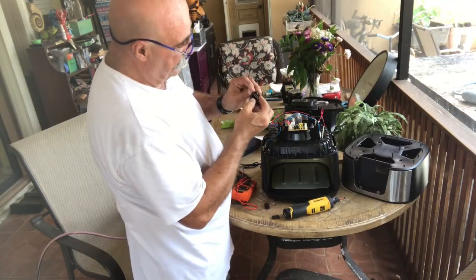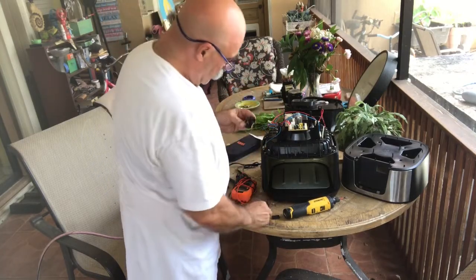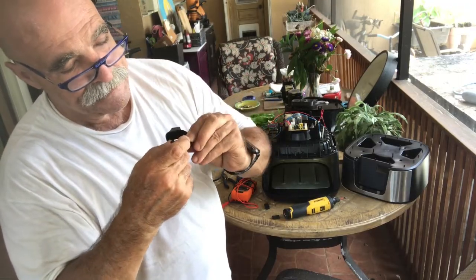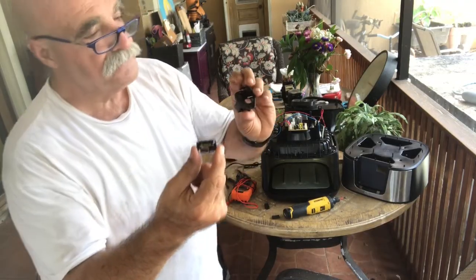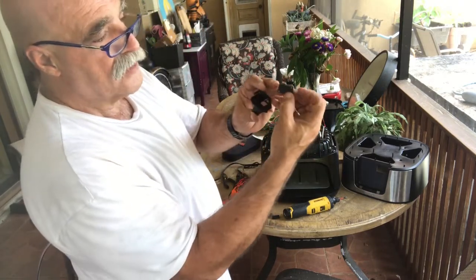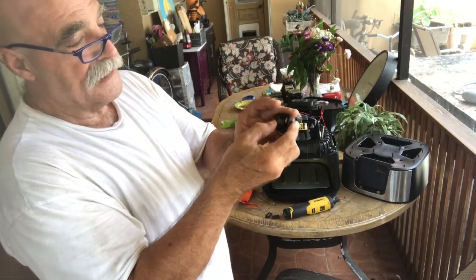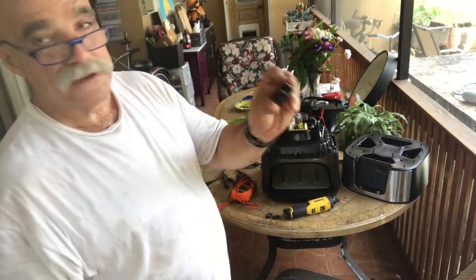This one is all shot. There's this thing here — you've got to move it back and get this out. Now the switch is out. We're going to take the new switch — it has holes for these rods to go on. You put it on here and push it down so that it goes into the slot. That's it — the switch is in, it's replaced.